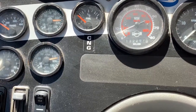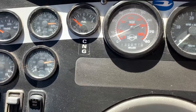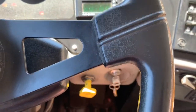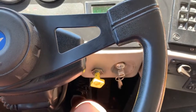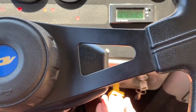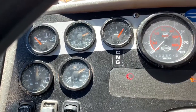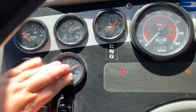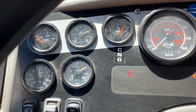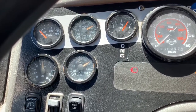We'll say that's one minute. Next is the A for applied test — note that on your actual highway patrol test you must do the full minute. For the applied test, I turn my key to the on position, do one full application of my service brake, release my parking brake, wait for my air tanks to level off, give the gauges a tap, and sit here and wait for one minute. The tanks cannot lose more than three pounds in one minute.